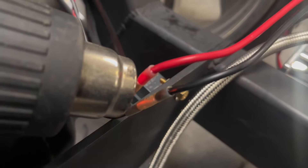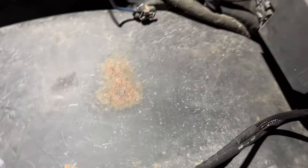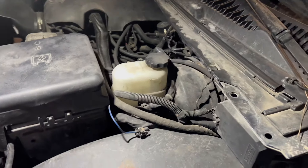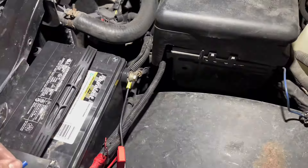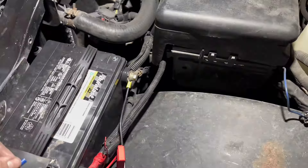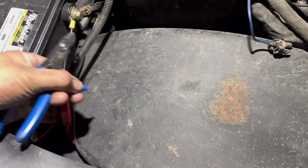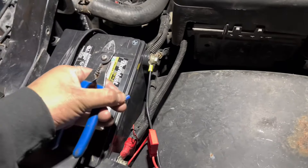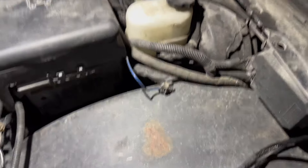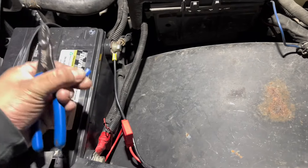There you have it — the power wire with the fuse, the ground wire. We ran it through the inside so you don't have wires just hanging around. This guy is debating bagging the front, so this might have to get redone in the future — but you'd just extend the harness. We like to put the battery back there, so we'd take it out and reroute it a different way, but right now it's here because that's where his battery is.